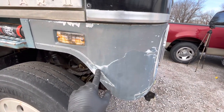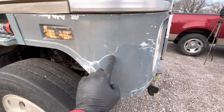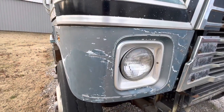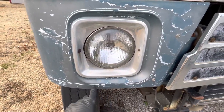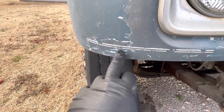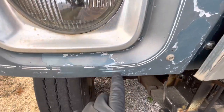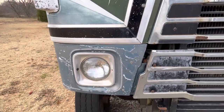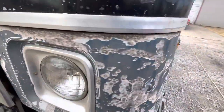I think this has been repainted, so it looks like that's old pin striping. You can see what looks to be different colors of paint — I don't think that's clear coat, it looks like two separate coats of single stage paint. But if I redo this truck to the factory paint, I'm probably going to redo the pin striping too. What I'd assume is that's the factory original pin striping underneath, and it just came apart probably from poor surface prep. I'll refinish this obviously when I do the rest of the truck.